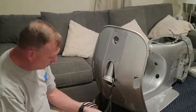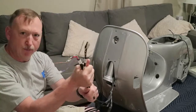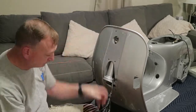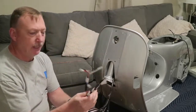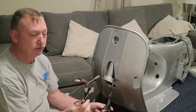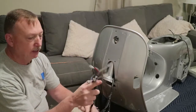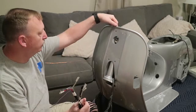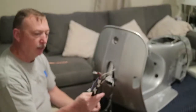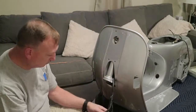Let's take a look at this wiring harness. The Vespa Motorsport guys in their video had only one bundle that ran up through the steering column housing. But my harness has two sets. I figured out which goes to which set on the handlebars. They ran their single bundle up one side of the steering column behind the steering lock, but I'm going to run one up each side.